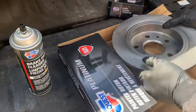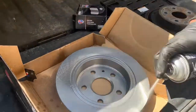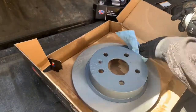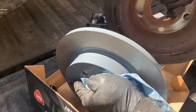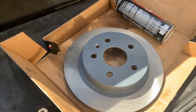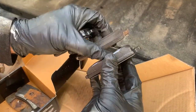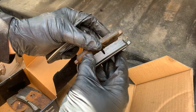Of course you always take this and clean it first — get any coating off it. When they store it they put some kind of coating on it to keep it from rusting. I already matched this up to make sure they were the same size. Just match the pads up and make sure they're the same thing. This is the platinum — it's got squeakers on both of them. Same size, but you can see on the old one there's no material left, so we caught it at the right time. You can tell the difference in thickness.